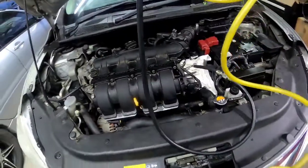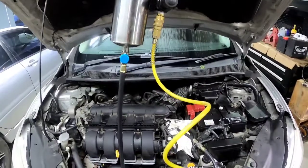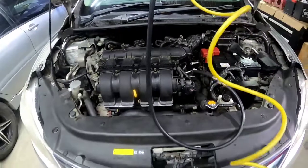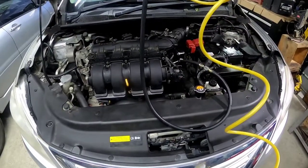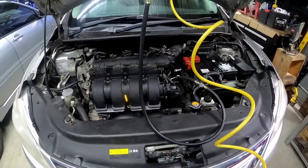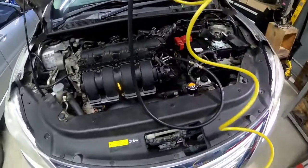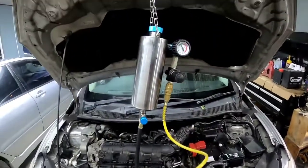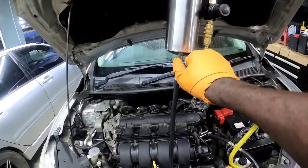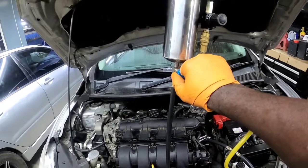This is a concentrated solution, so it's more potent than the kind you put in the tank. This helps clean and decarbonize all the carbon buildup beyond the injectors. While the vehicle is idling, if you see the pressure drop a little bit, you can open the regulator a little bit — go up to 45 PSI if you want.